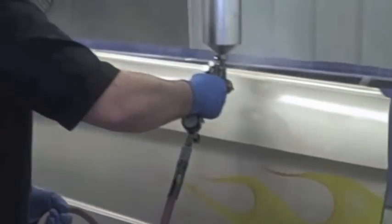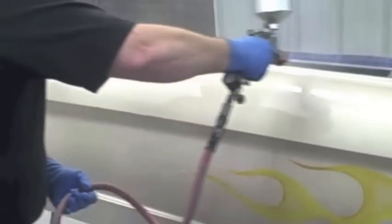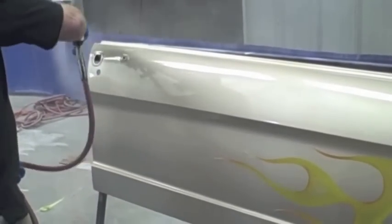Now I'm applying my second full wet coat and this is my final coat. Once that's done, the panel will be completed — that will be how you do it. You could sand and buff it out if you would like, and if you're going to be doing a lot of sanding and buffing, you may want to put a third coat on for extra film thickness. That pretty well wraps up this video — I hope it's helpful, and if you like it, be sure and share it with your friends.